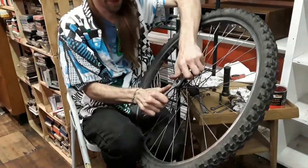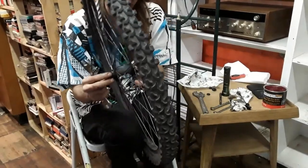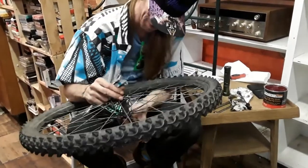Yeah. What we're doing is we're locking these together so that your axle nut doesn't back off and everything get loose. That would be bad going down the road. Yeah. Front end. Loosen up your bearings and they go bad and burn up or something.